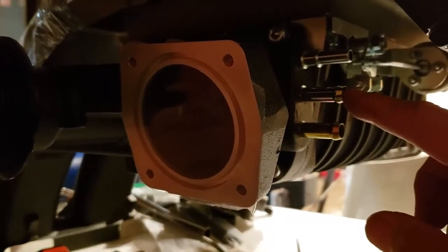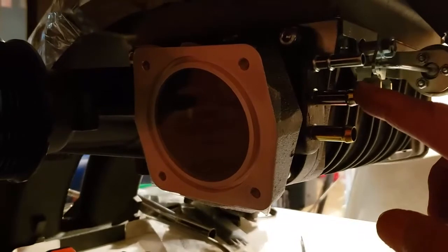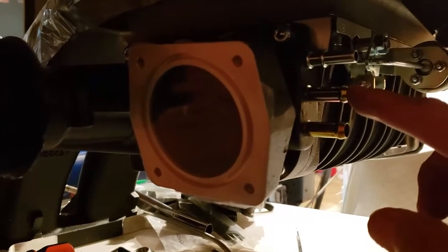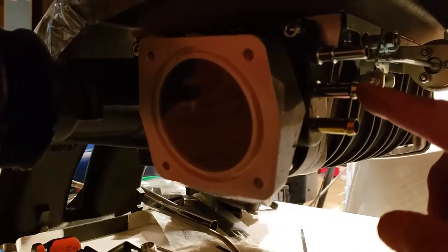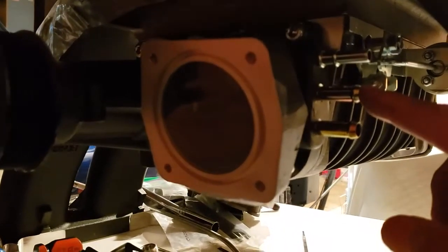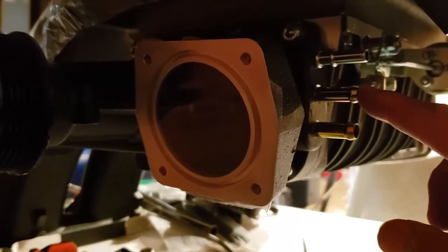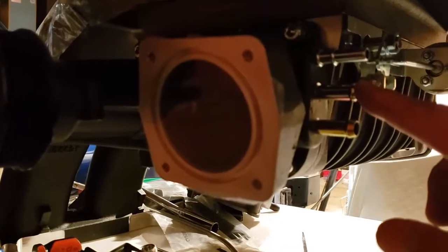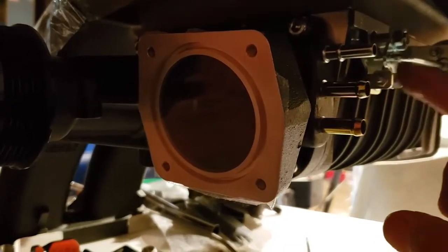You cannot connect your breather tube into your intake. You are going to suck oil. I just pulled my engine apart. I should have done a video on that, but I didn't. Now, I disconnected this a little while ago, or I reroute it is what I do. I reroute it so oil can't get into the engine. Okay, I'm going to show you briefly how I do that.